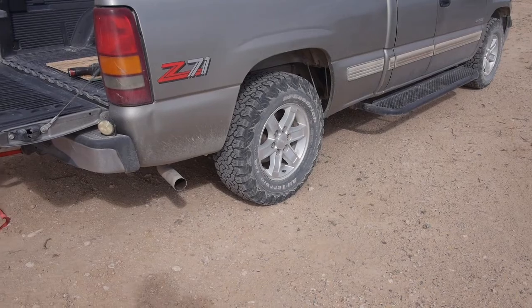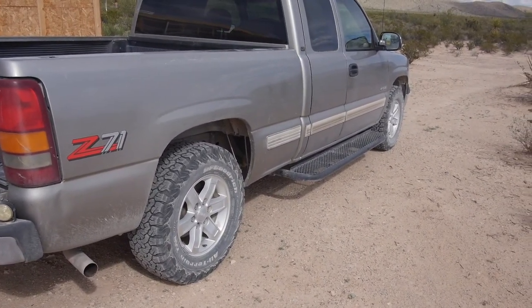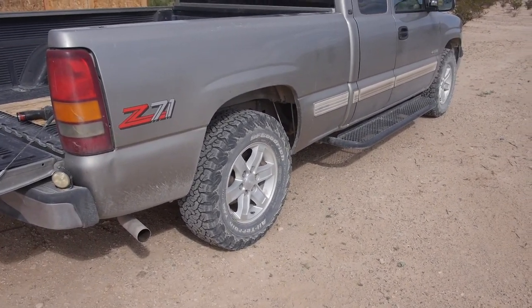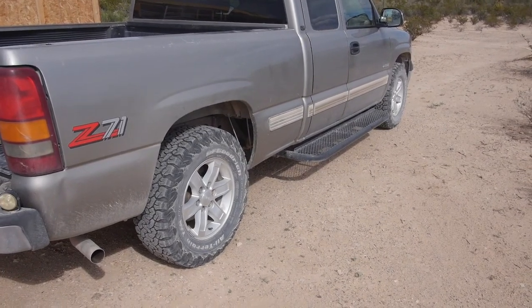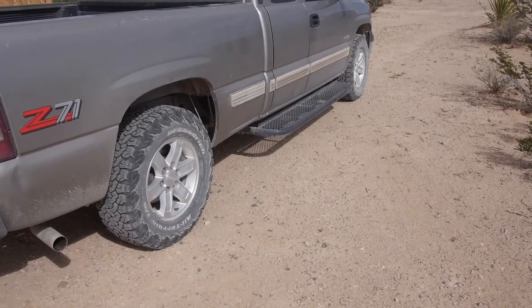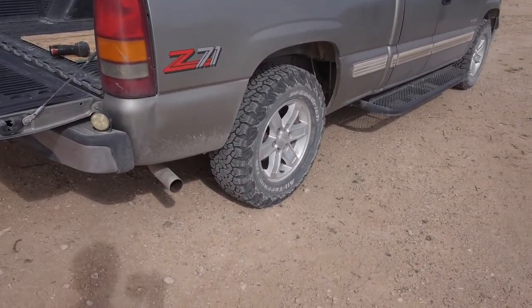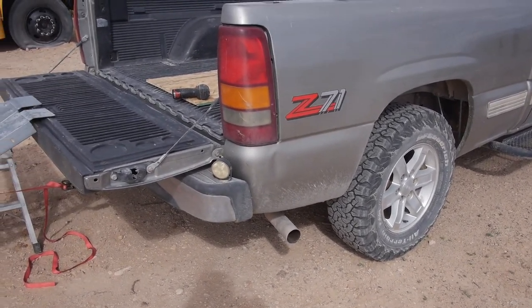And since I don't do that kind of thing very often, if you push your brakes all the way down, the backs will engage and you won't do anything. So kind of slowly let off the brakes and you'll feel the weight transfer. The back wheels will start spinning, the front wheels will still hold because all your brakes will go to the front then. And I was able to spin them down pretty good. That made a difference, a couple inches here and there.